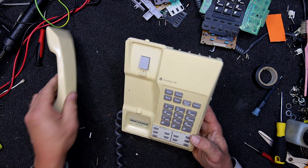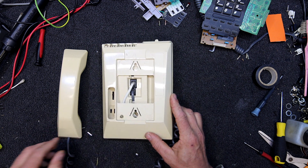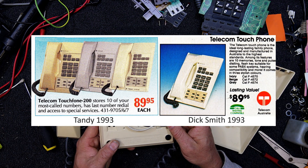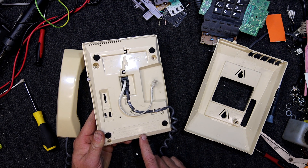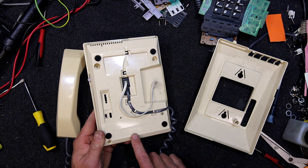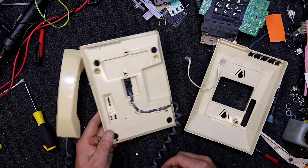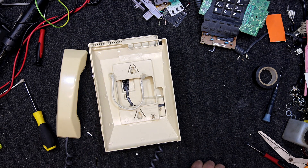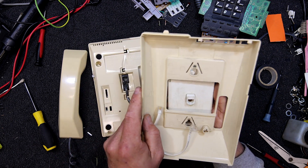The wall mount kit has a little piece that presses in to hold the handset up and the wall mounting bracket itself - they've actually made them in the same color. These were sold by Dick Smith and Tandy in sort of early to mid 90s. It's made by Alcatel, manufacturing design in Australia, manufactured for Telecom Technologies. That's how you know it's a sale phone not a rental one - it's got this 008 number on it. It's a TF200, originally got the Austel permit in 89.